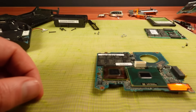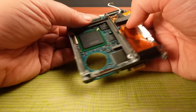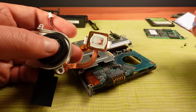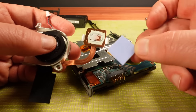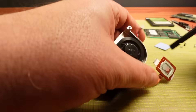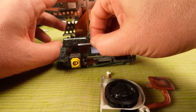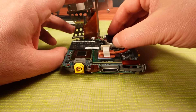I'll put the old board aside. Now time to get it back together — it shouldn't be that hard, just reverse the process. I've spent some time searching around and I can't find my thermal paste. So instead of thermal paste, I'm going to be using a thermal pad. This doesn't work quite as well as thermal paste, but this is a fairly low power environment so it shouldn't be much of a problem. With the thermal pad on, I'll drop the heat sink back on.